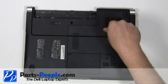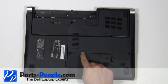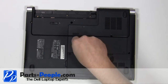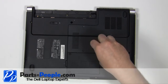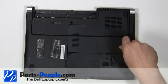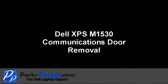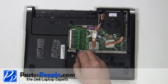Remove the 2.5mm x 5mm screw. Loosen the four door cover screws and remove the memory door cover. Loosen the two screws and remove the communications door cover.